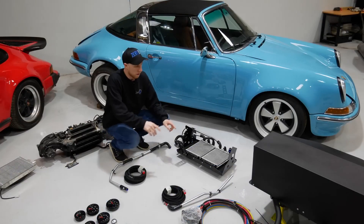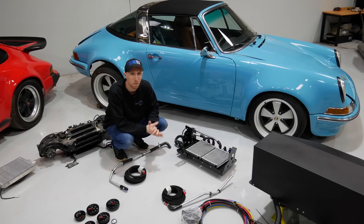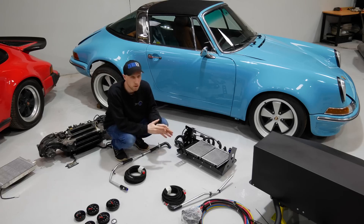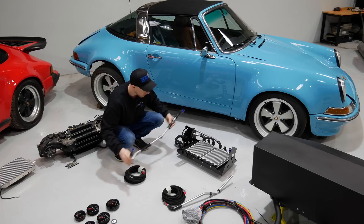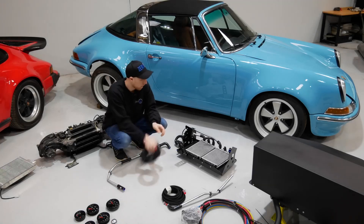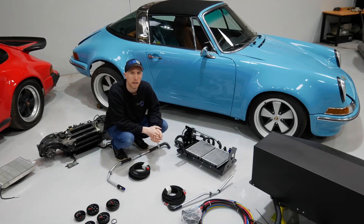This is our rear cooling system. We have two coolant loops — one for the batteries, one for the motor setup — with two radiators, two water pumps, and two fans. The radiators, water pumps, and fans are all standard off-the-shelf VW components. So if in the future you ever get an issue, these are the consumables that could potentially fail in five or ten years' time — easy to get hold of from your local motor factor. They come with pre-made aluminium piping and silicone hoses clocked correctly to go straight onto the drive unit for either side, and pre-made water piping for the front-to-rear battery box loop. All of this comes pre-assembled from us in a box. Once you've got your battery box up in place, you lift this up, bolt it in, and then run your coolant push-fit fittings and systems in afterwards.